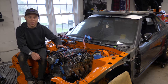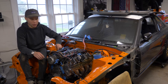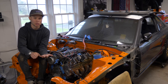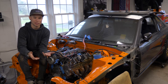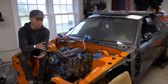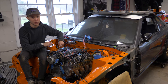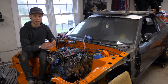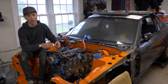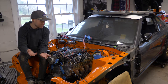What's up guys, we're back and made a ton of progress on this wiring since the last video. Essentially what happened was I went through all the different legs of this engine harness, pulled it out, and removed anything that was not needed — stuff like transmission control, emissions stuff, and different sensors that we're not going to be using. I've slimmed down the harness to just the bare essentials, and right now I'm starting to route it through the engine bay, trying to keep things as clean and tight as possible both for appearance and for simplicity.